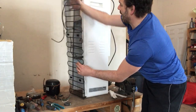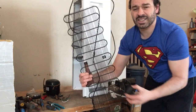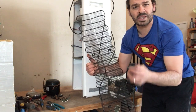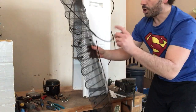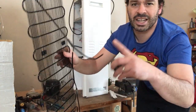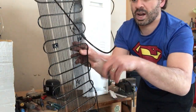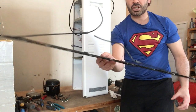The black casing on the back — you do want to run a magnet down it. As you can see, this entire coil apparatus is going to be going into my tin shred pile. There are sometimes black or silver boxes connected to this that you want to take off and open up, because they will have some copper inside and usually a silver contact. This one doesn't have it. You also want to make sure the wires — the ones that connect to the compressor — you cut as close to the copper as you can. This is going into my tin shred pile and is actually three pounds worth of tin shred.